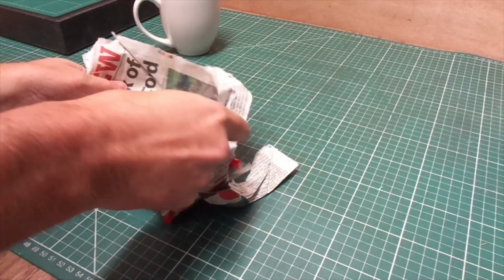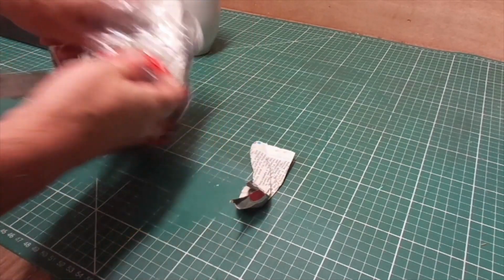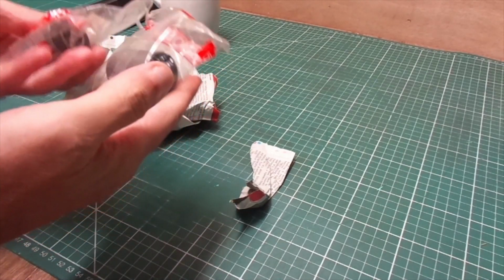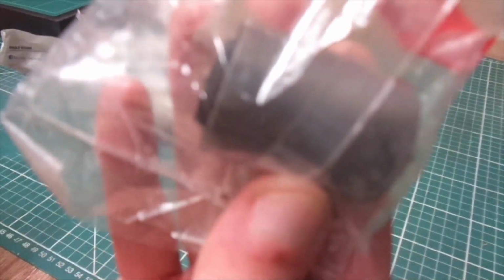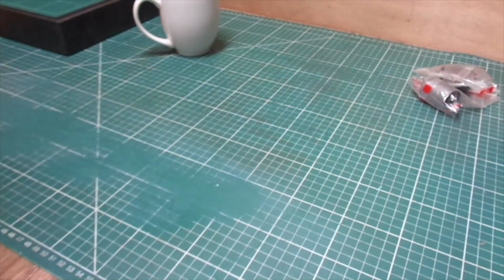So what's in here? That'll be the metalastic bearings for the upper cross member I showed you earlier. So they're going to have to go in there. I couldn't get the right size. They're 1/4 of an inch too short, and the inner diameter is 9/16 instead of 1/2 an inch. But sue me, I'm going to use these anyway. The other ones I just can't get hold of. They're just not available.